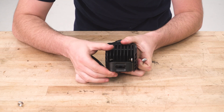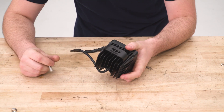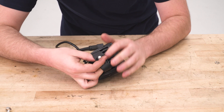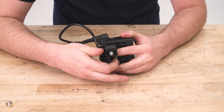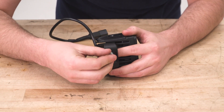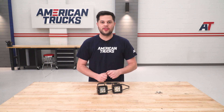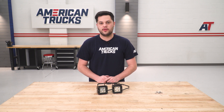Now that we have that in, we're just gonna move that up to the top like so. How this is gonna attach — just take a 13-millimeter bolt which does come in the kit with the lights — that is gonna sit up in that bracket, and you can tell there are two little cutouts right there to hold the bolt head still while we come in from the top with a 13-millimeter nut. You wanna do the same exact thing for the other fog light included in the kit, and then we can take these as well as our hardware back to the truck to install them into the pods.